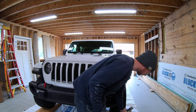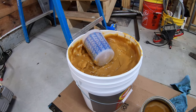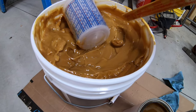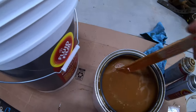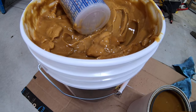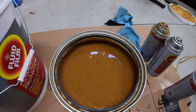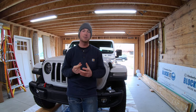You really have to get this Fluid Film warm before you spray it. When it comes, like I said, it's like a Vaseline consistency. So what I like to do is heat it up in a pot of boiling water and then drop the paint can in that. I'm not going to tell you that's the safest way, but I found that's what works best for me. Heat it up until it's literally like oil or fryer grease — just a liquid consistency — and then it should spray. So I think I've got everything ready. I'm going to get suited up and then we're going to get to spraying the Jeep. I think we'll start in the hard-to-reach areas first.